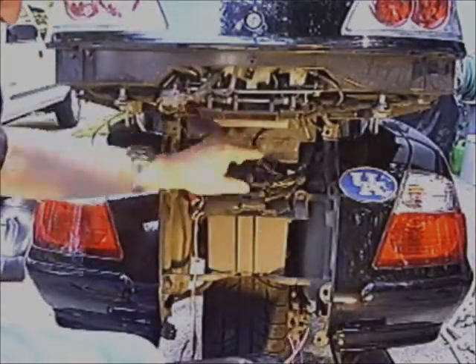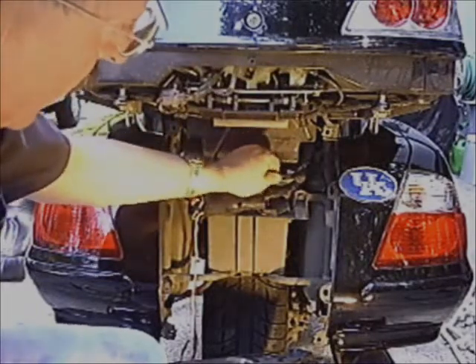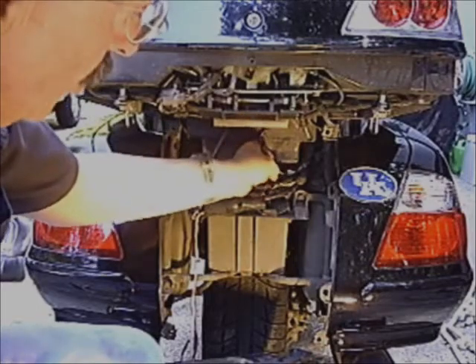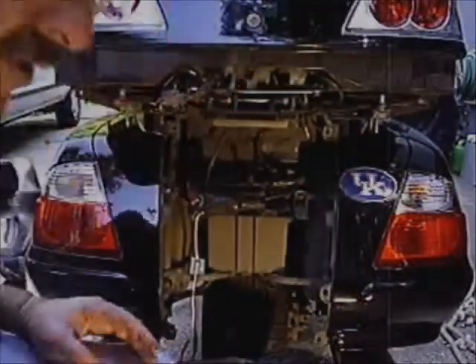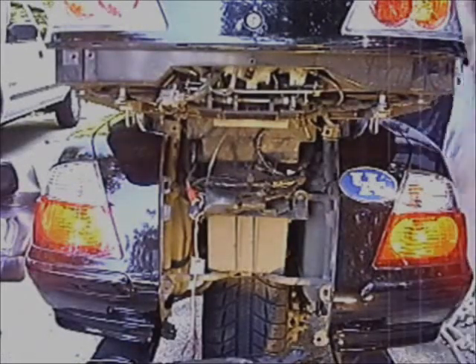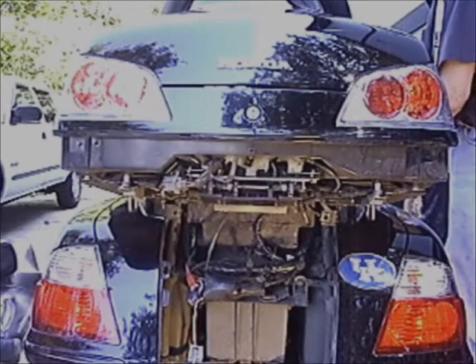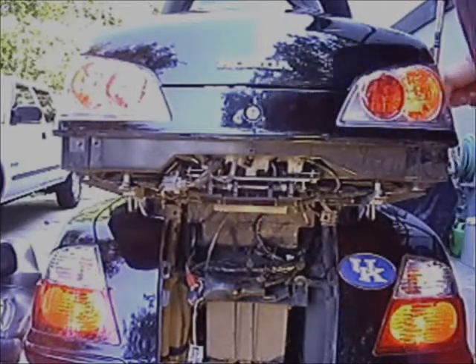It's going to be a lot easier to splice them in down here. I've already cut into the wiring harness cover — both the left and the right — and located the green wire with the red stripe on each one. That's the brake light wire. The next step is to make sure your brake lights are working, so I'll turn the ignition on and operate the brakes. You can see both brake lights come on and then go off. The handlebar switches are really sensitive. My run light is out, but I'll get to that another time.